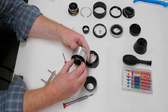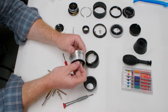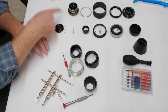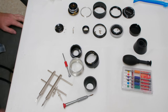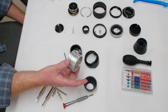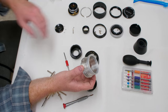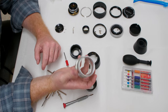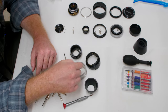Let's take this piece out. I'll unscrew it and eventually it will come out the back. That's the entire lens apart. I haven't messed with the element groups and I'm not going to — there's no reason to, and taking them apart would expose them to dust or fingerprints. I'm going to clean up these pieces; they're very clean to begin with, but I'll do it since I have it apart and we did see some oil degradation earlier.